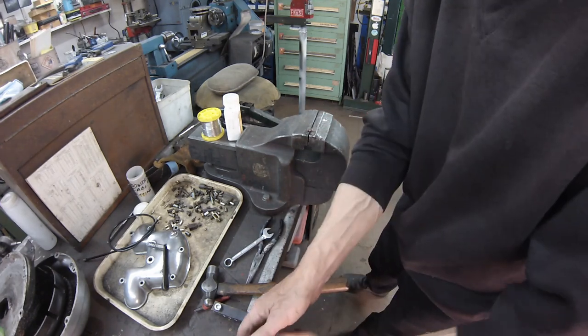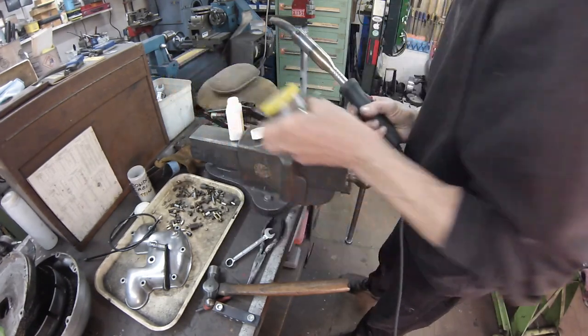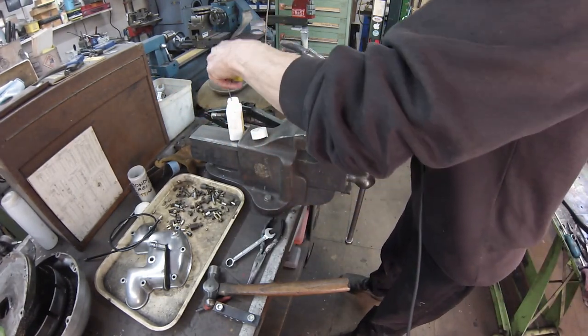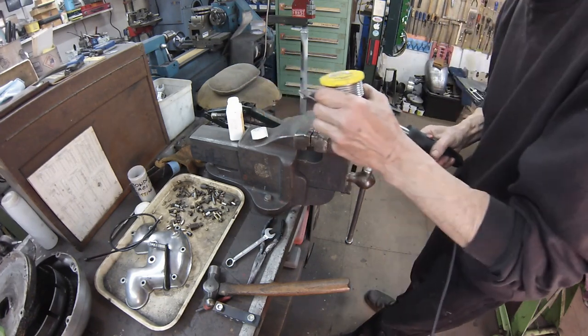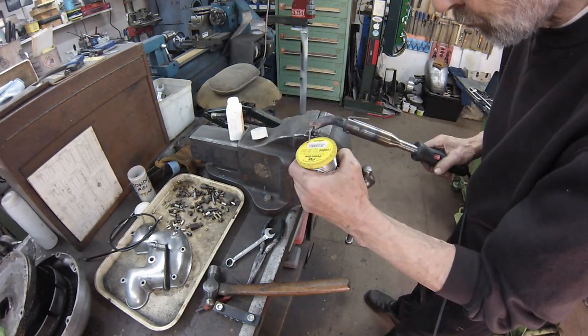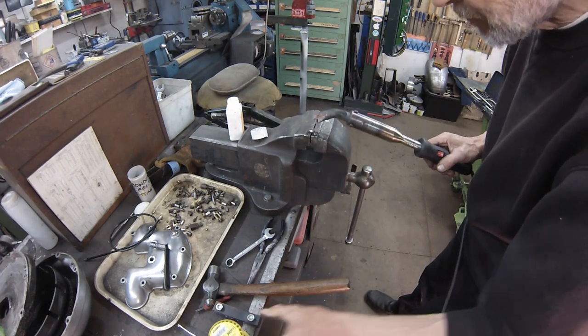A flame can be used with care, but taking the steel wire to red heat will soften and reduce its life where it is most stressed, next to the nipple. Keep the joint still until it is completely set.